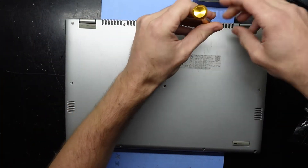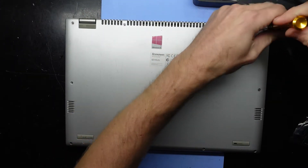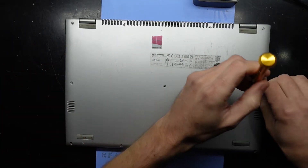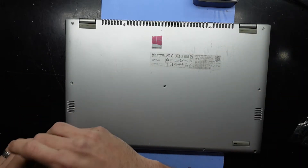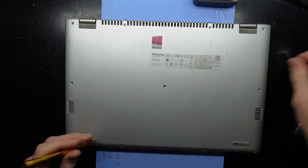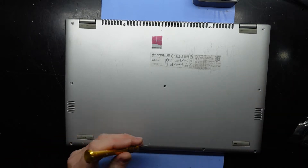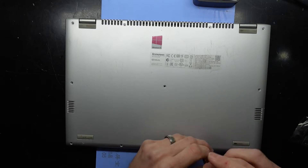This one does have a 500GB hard drive in there and it is somewhat failing. It also only has 4GB of RAM, which in today's world is not really enough. Start loading up things like Norton running in the background on this machine and it just absolutely eats that RAM — as soon as you turn it on we're already sitting at about 80% RAM usage, before you even start doing what you actually want to do.